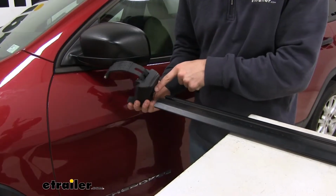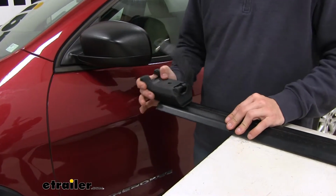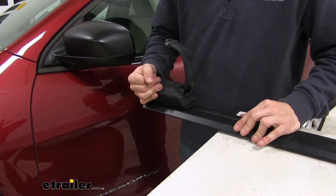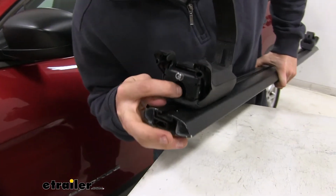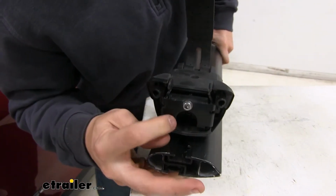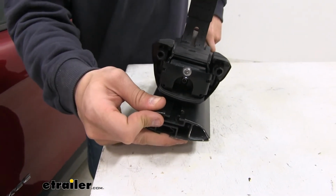Now we'll just slide these notches into the channel on the back side of our JetStream crossbar. Now if you find that you're having trouble and maybe it's not sliding in all the way or you're having a hard time with it, what you can do is actually come to the inside of the Timberline tower. There's going to be bolts down on the inside where my finger is. You just loosen that up and then it should do the trick to let you slide it into the channel. Once you have that, we're ready to put it on our roof.